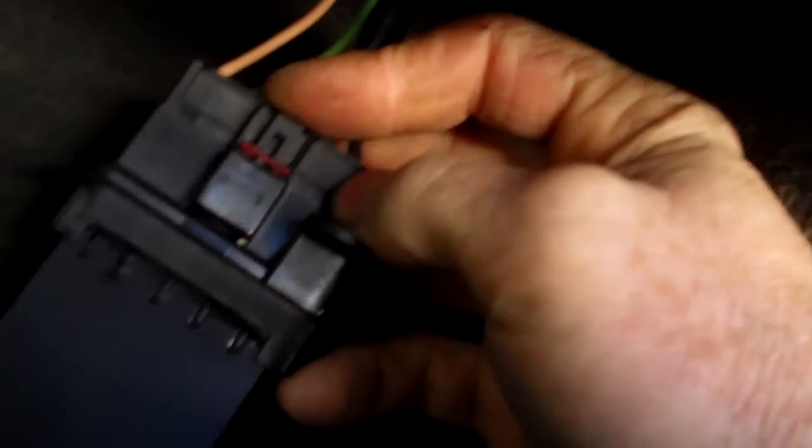That's what happened with this old one here. Chrysler has these — there's no other way to say it — god-awful safety clips on everything. You have to get a screwdriver and get that stupid red clip out of there before it'll unbuckle like any normal plug. I'll get a screwdriver and take care of that, plug the new one in, and we'll go from there. Of course, if this is on a minivan, you'll find the blower motor resistor under the hood, because the whole box containing the evaporator and heater core is in a big plastic box under the hood — like on a Chevy Astrovan or GMC Safari. So look for it there.